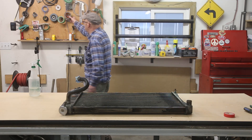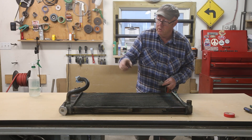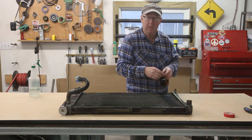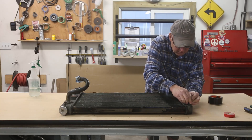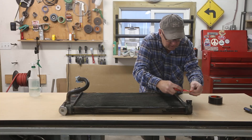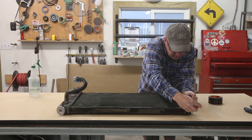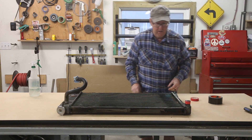So what I'm going to do is just take a little bit of duct tape, and I'm not going to pressure it right up to 120 pounds — I'm just going to maybe go to 20 to 25 pounds and then I'll blow a little air in there with this submerged and we're going to see if we can find the hole. So we'll just cap it off and I'm going to run some electrical tape around there. I figure that's going to help keep it a little more sealed off. Just tighten it up because you've got little folds and things like that. Okay, let's go outside.